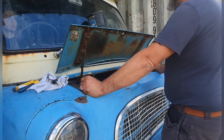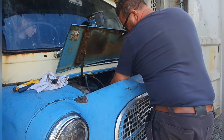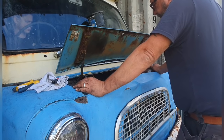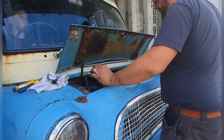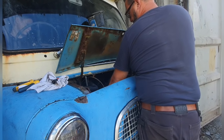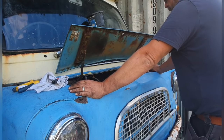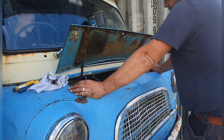Right, woo! That cleared the exhaust pipe. Okay, Jesus. Let's back that off a bit. It's slightly too advanced, I think. Right, give another go. Bit better. Try again. Hold on. Okay, try again. Right, take the choke off a bit. A half choke will do. Okay? Yeah, ready? Yeah.